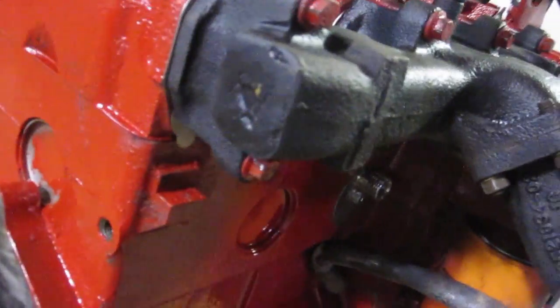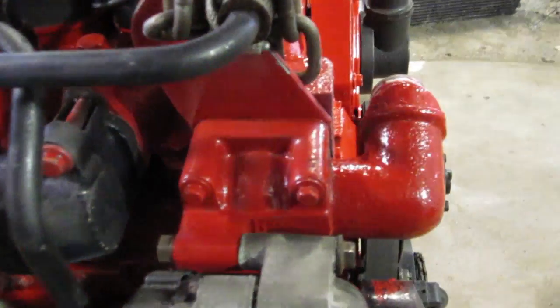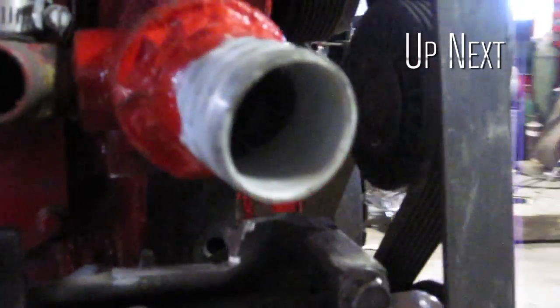You can weld the end shut. You're going to want to keep it positioned ahead so it doesn't hit your receiver dryer of your air conditioning. You're going to want to use the coolant lines off of the 5.9 so that it looks nice and neat. You're going to want to use the factory alternator and just adapt it to fit the brackets that were already there.